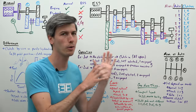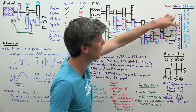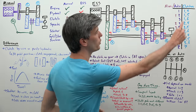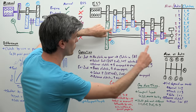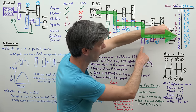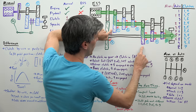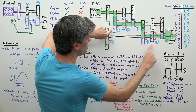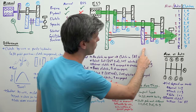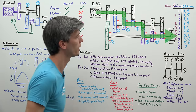To recap how automatic mode works: for any of the nine gears you need to use two clutches. For gear one, clutches one and four are engaged, and power flows through those to the driven wheels. To switch to second gear, you use clutches one and five — four opens, five engages, and power flows through one and five. For third you use one and six, and so on through all nine gears.